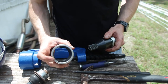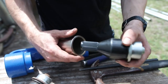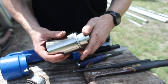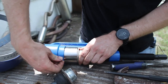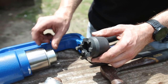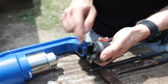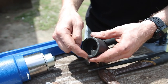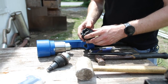So you're going to want to flip this over now so that the thinner diameter or narrower diameter is at the top. Insert your new ball joint — we're just going to keep the protective cover on here to protect the threads while we're working on it. Then you're going to slip that into the receiver here. Now these are the teeth that are going to crimp down on this top lip right here and make it seal against your lower control arm. While you're pulling this up through the hole, you're going to flip it around and pull it up using this side. Once it's all the way through, then we'll flip it over and crimp down on those corners.